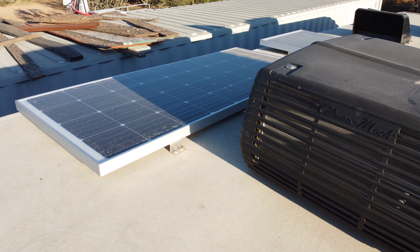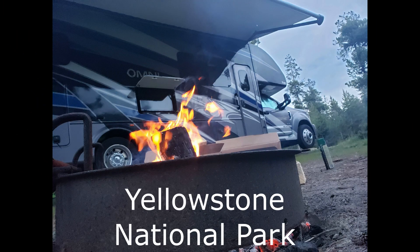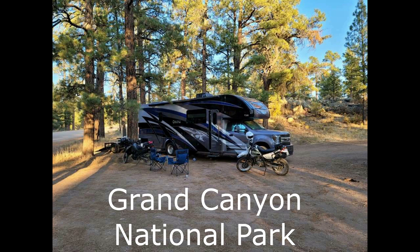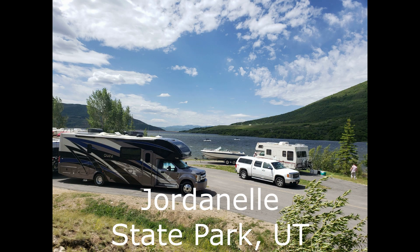Why did I do this? With my travels this summer I was able to visit Yellowstone, Grand Tetons, and Grand Canyon, and I didn't need to worry about having power at any of the sites. The only thing you'd really need power for would be running your ACs — the weather was nice where I was, so I didn't need that. The fridge, all my electronics, everything worked. The batteries never drained. The three 190-watt solar panels and the two 250 amp-hour lithium batteries was plenty of power for everything I needed to do.